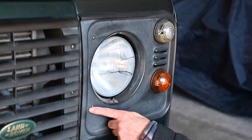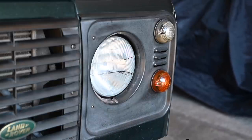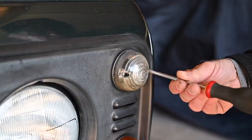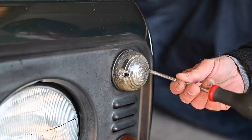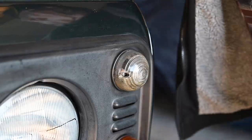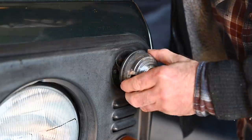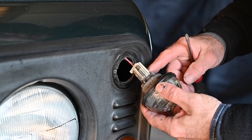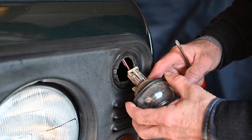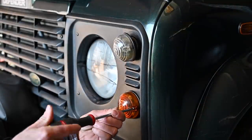To remove the headlight you need to remove the running light, remove the blinker, undo those two screws, and then the whole panel comes off — then you can get to the headlight itself. These screws can sometimes be tough to get out if they've rusted, but in my case that seems okay. I'm going to place these screws on top so I can find them afterwards. You can now see the connectors; on mine it may be different — this is a 2002 model, and I think they changed the connectors in 1998.